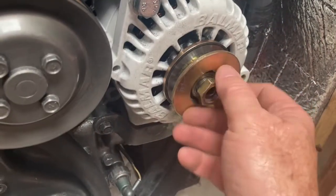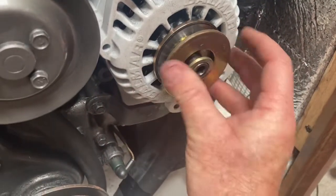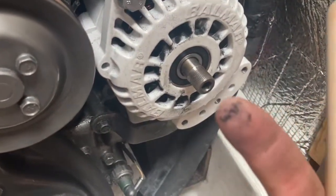With this system I'll be able to run my alternator at 100% capacity. With the small V-belt I wasn't able to do that — it was programmable to moderate the amount of energy it would take from the belt. Now I can run the alternator at 100% efficiency, shortening charge time. More importantly, I hope to line up the belt better because the old belt system was starting to wear and creating a large amount of belt dust, which was getting into the alternator and causing it to not cool as efficiently.